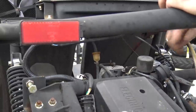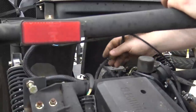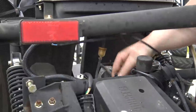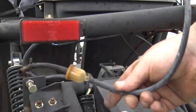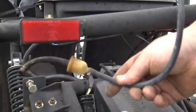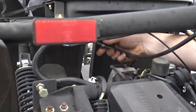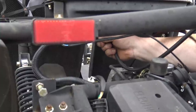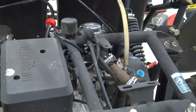I already checked the tank and it is bone dry, so we're going to pull off this fuel line — it is pretty crusty — and go ahead and replace it with a brand new one. You can see that fuel filter is pretty rough and the fuel line is pretty stiff, so it'll be nice getting a new fuel line and fuel filter. Then we can pour some gas in and see if she'll start. This go-kart has 3/16ths fuel line on it, so we're putting some fresh 3/16ths on there. The other one was extremely loose, so now we've got the fuel line replaced.